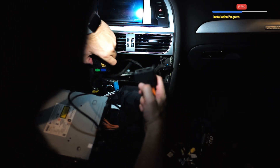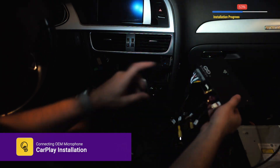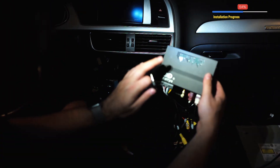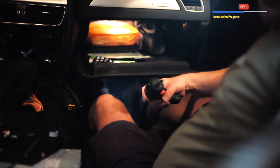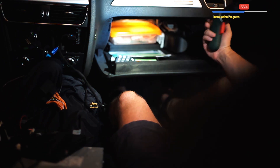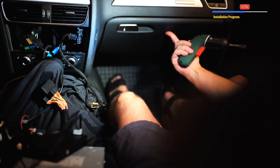This one will go to the back of the mic. If you want to use your own — I have a Bluetooth mic which works very well — I've heard there are issues with the included one giving an echo. You have to plug the mic here, so we'll have to remove the glove box. There are three screws up here, one here, and two down there.